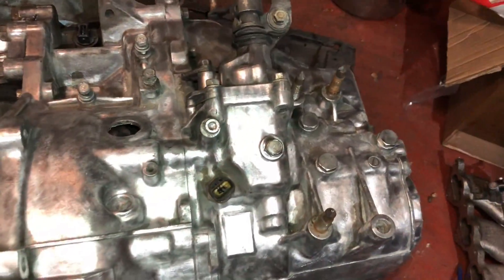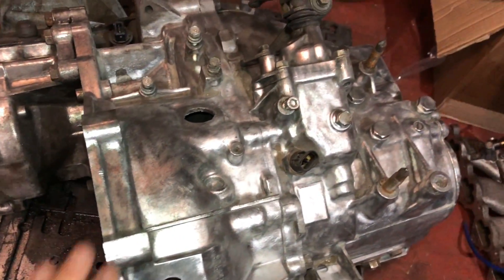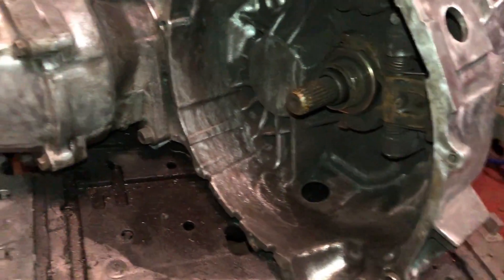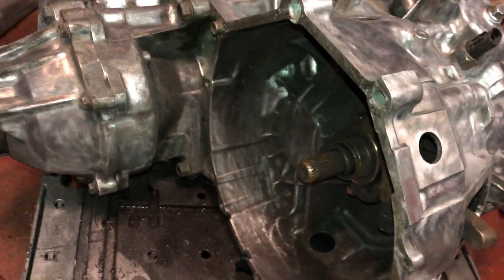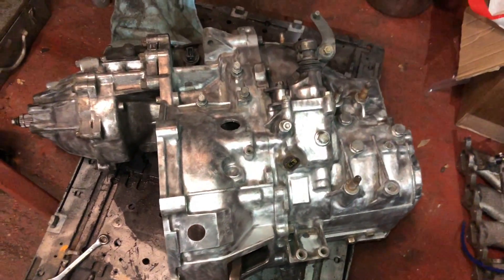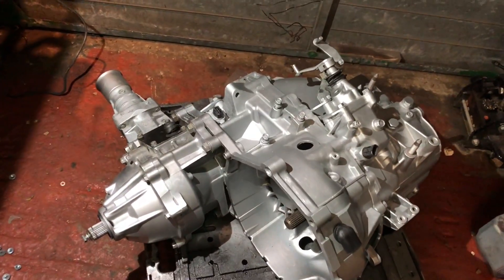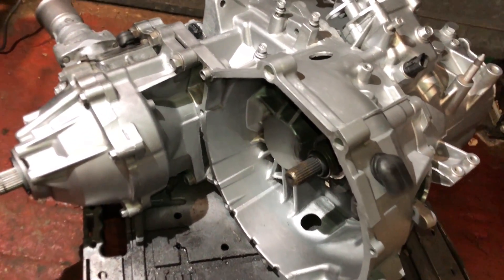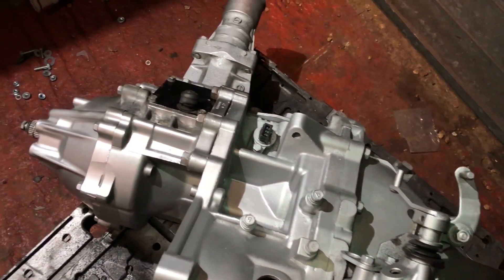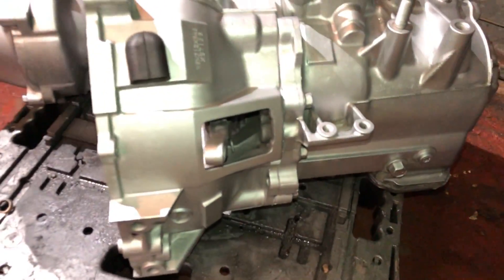Well, that's looking a lot cleaner - just went around it all and got all the oxidisation off. I'm probably going to give it a quick lick of paint as well so it doesn't re-oxidize. I do like the bare aluminium finish but as soon as you get any salt on it, it just oxidizes again. I've obviously gone in and cleaned out the bell housing as well. I'm going to change that release bearing, then get on with doing the inlet manifold and spruce that up too. So I'm going to give this a quick coat of paint now. There we go - the gearbox is all painted up, cleaned up, all done properly. A million times better than it was.